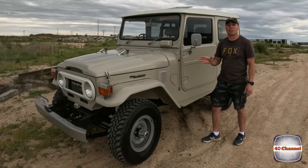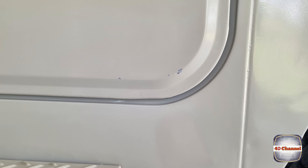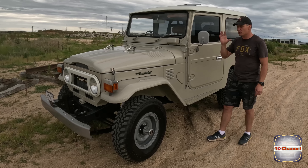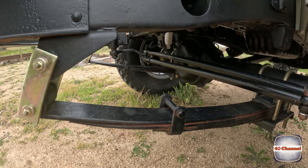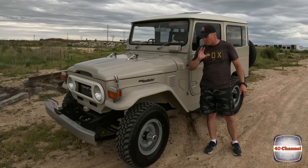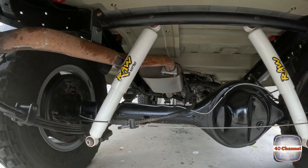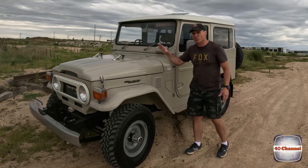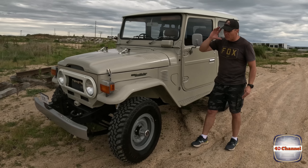It has been on the road and been driven around and used for the last two and a half years. So it does have some little tiny stone chips and little bits and pieces, but overall it's in pretty much the same condition that it was the day it was built. As you guys know, from the ground up every single rubber seal, every single bearing, every single joint, bushes, shackles, new suspension — all from the ground up has been done. This one here has disc brakes on the front. It has a 60 series rear end handbrake setup, 60 series 2H and 4 speed motor. So, to try to keep it genuine looking, we've gone back with the split rims.